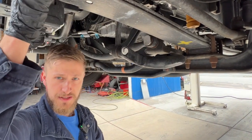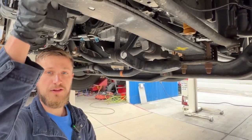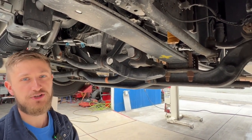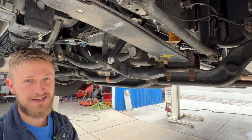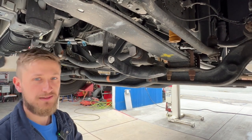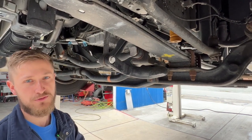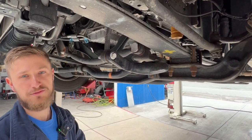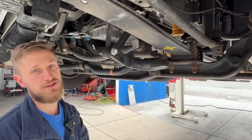We initially tried: if we've got soft spring bushings, we'll go to stiffer ones. We went to polyurethane bushings, and the problem then was that the ride — which is already not great on this chassis — got even stiffer. That gives us some clue as to why Ford chose to use such soft rubber in the spring bushings. So we decided we had to come up with a different way to solve that problem — and that's where the radius rods came from.